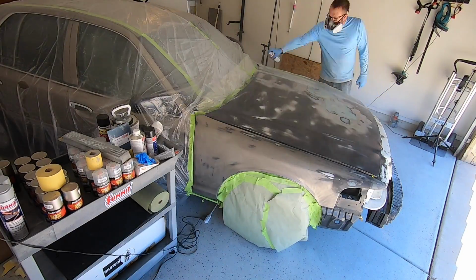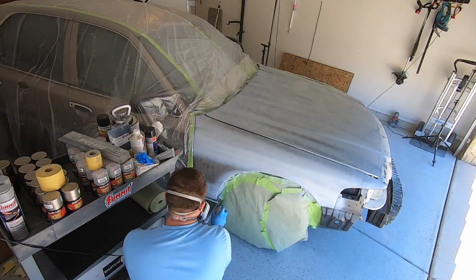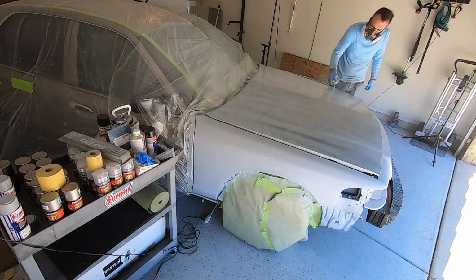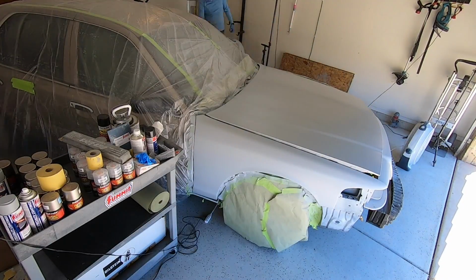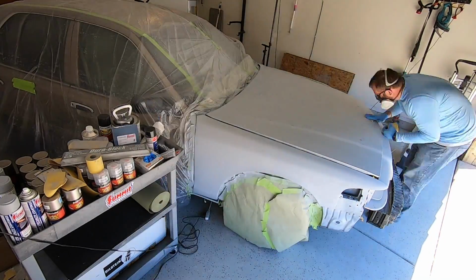So what happened was I got in next to the primer, and I did use a self-etching primer because for the most part, a lot of the panels were kind of exposed steel or just that factory e-coating, they call it, which is not a primer, but just a coating that they put on at the factory on these panels to prevent rusting. And I sprayed all the panels, including the plastic bumper and the fiberglass header panel, with this self-etching primer. Primer actually looked really good. When I sprayed the primer, I thought, this is really in good shape.